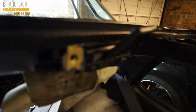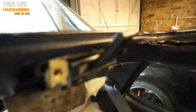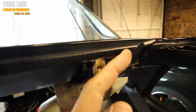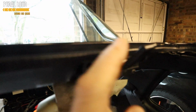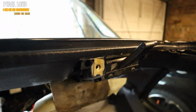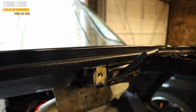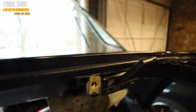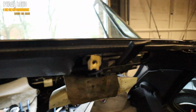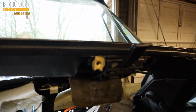Can you see? They're in a position where, I can focus on that, they're in a position where the sunroof is grabbed. Okay, that's what you want. That is spot on. Right, the sunroof arms will now only retract into the body, which sort of makes sense if you think about it, because you don't want to be driving along and retract the arms in and the sunroof fly out, when the ignition position is back to its first position. I think we call it accessory.